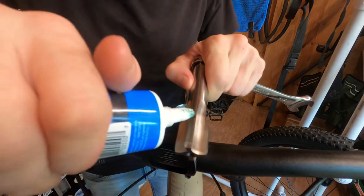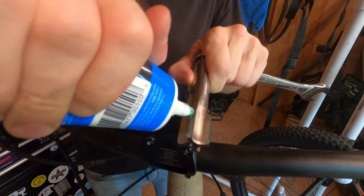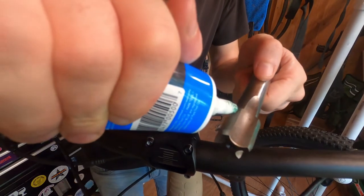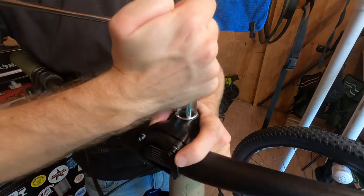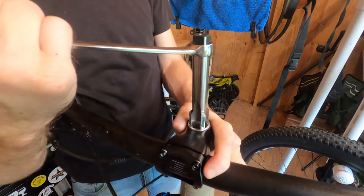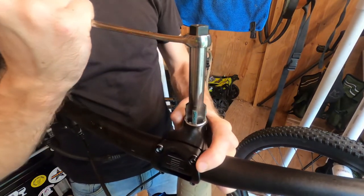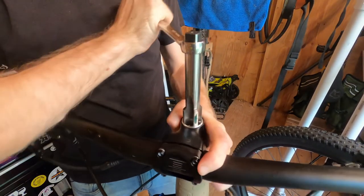Next, put a little bit of lubricant on the cutting edge. We're not doing any high speed cutting or generating a ton of heat here, so if you don't have any cutting fluid, some bearing grease or bike lube will do the trick just fine. Remove the front wheel and stick a bucket under the fork to catch any aluminum shavings. Then stick the tap in as straight as you can and just start turning. For every full rotation of the tap, back it out about a quarter of a turn — this will flush out any extra aluminum chips that are stuck in the tube.